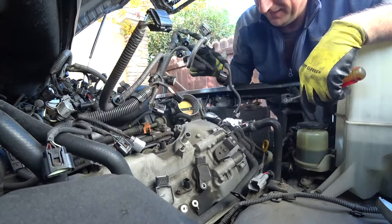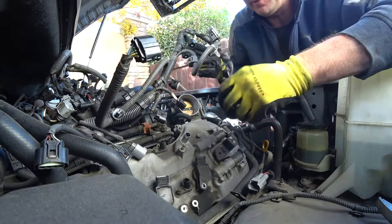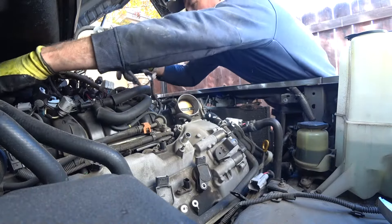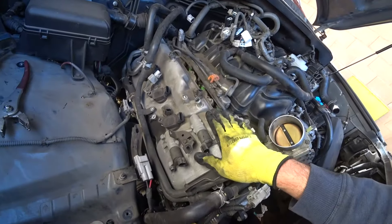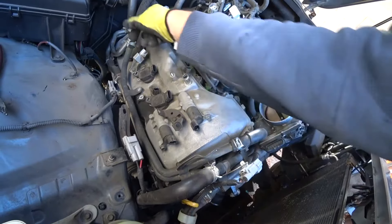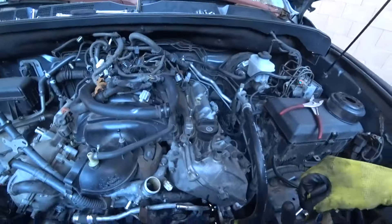The hardest things to disconnect are the wire harness mounting clips — the plastic is dry and really hard to disconnect. Be very careful not to break the connectors. After you disconnect them you get pretty good access. The heater hose line is the last thing left. Disconnect the heater hose and pull it out, then you have full access to loosen all the 10 millimeter bolts around the cover and pull it up.